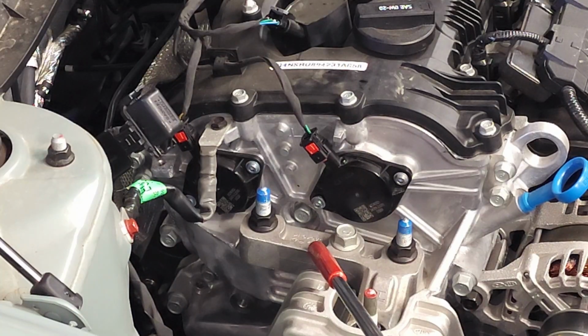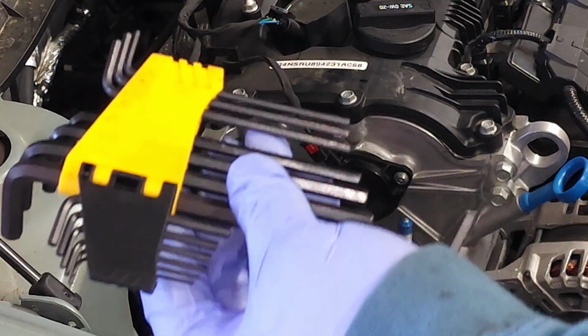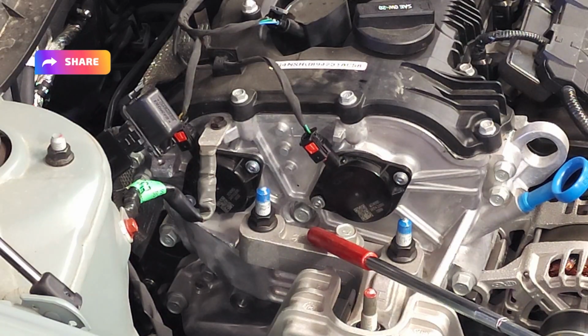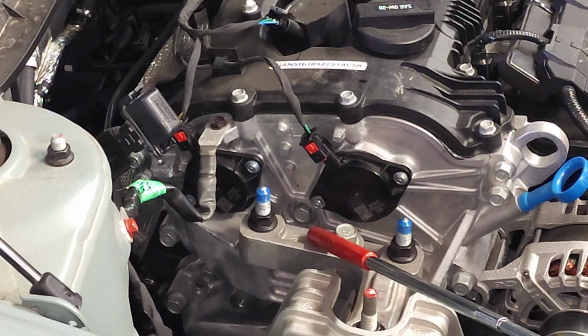So let's quickly go over our supply list. As I mentioned before, we have two different solenoids. There's the intake solenoid and the exhaust solenoid. We may also need engine oil and oil filter. Looks like a 5/32 inch hex tool. You're also going to need some Loctite for the bolts when you reinstall them. There's a small amount of Loctite that needs to be applied to the bolts, and you could use some engine degreaser to clean the solenoids and some carburetor cleaner as a final polishing cleaner to remove the more harsh engine degreaser. Please see other items in the description below. So let's go ahead and move forward with the removal and replacement of the VVTs.